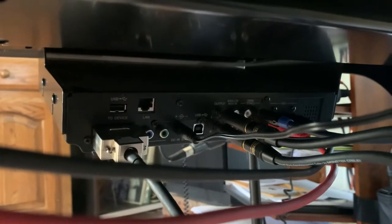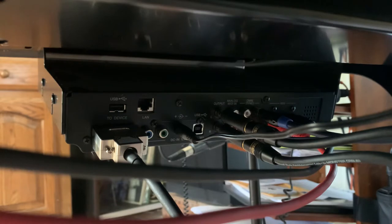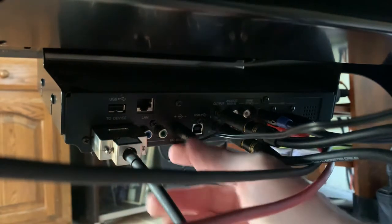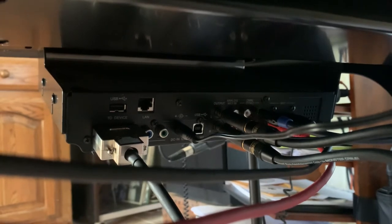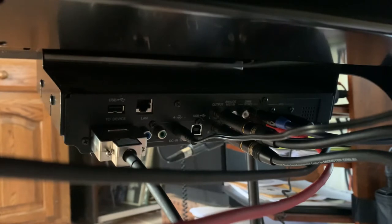One thing to tell you though, since I had always had that old unit, I kind of stowed away all the extra parts that came with the GK850, including this cable. The connectors are a standard 15-pin, but the wiring is not standard 15-pin. So I had a hard time finding this cable, and I had the bright idea that I could just buy an SVGA cable, 15-pin, male to female, and that would be good to go. Don't waste your money or your time. That was a bad idea. It didn't work. So hopefully I've saved you a little bit of money.